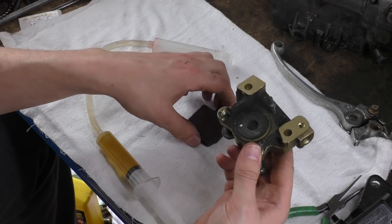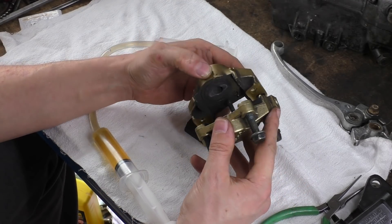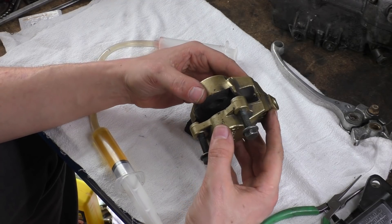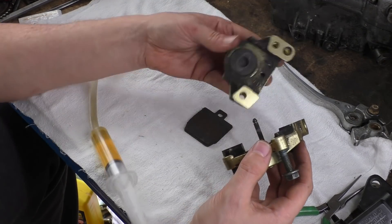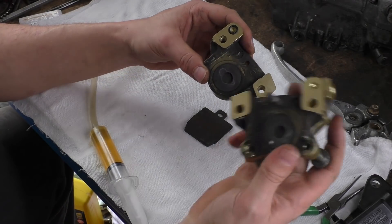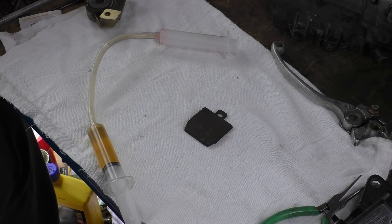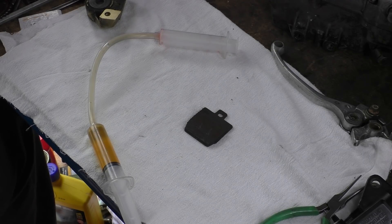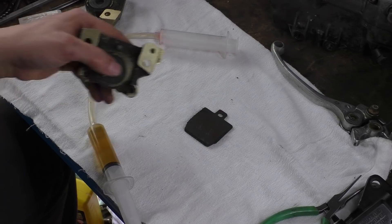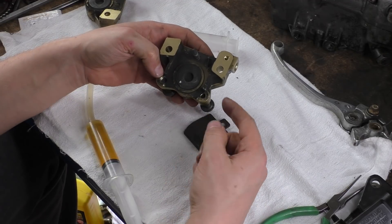In a sense, this is our piston-type caliper, and I've got a baby Brembo — this thing is tiny. We have our brake pads and piston in here, and a passage between the two — it's actually a dual-piston caliper. There's an O-ring between the two halves because that's where fluid passes from one side to the other. In a sense this is like the SV brake — they've just doubled up and put two pistons and two pads.